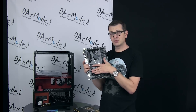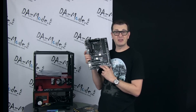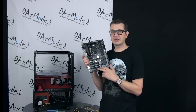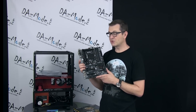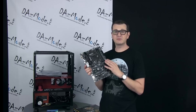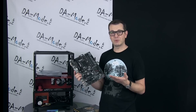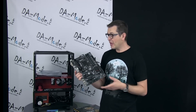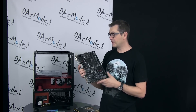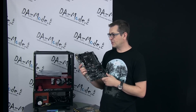If you have an SLI configuration utilizing both slots and you want to put an SSD in the last slot, that's not a very good idea because you start running into a bottleneck situation. Moving on — obviously, since it's Skylake, you have DDR4 type memory with four banks, which is perfectly fine for most standard gaming setups or in our particular situation for the test bench. We don't really need anywhere near the maximum capacity those four banks can provide.